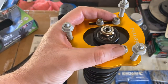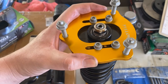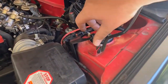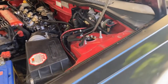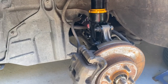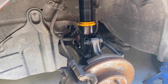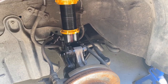As you'll see they came installed all the way to one side, so once I break those four loose, this is where the pivot comes from for the camber adjustment. Let's get stuck into this passenger side. There's a little plastic clip that we had to remove here which holds some of the battery power harness. And there we have all four coilovers installed — this one here is just buttoned up to the original hubs still. I've undone a bolt down here for the front sway bar — just got four bolts under the car and I'll pull that out.